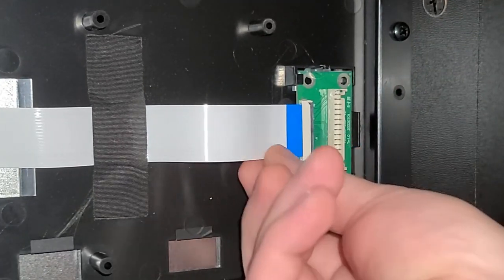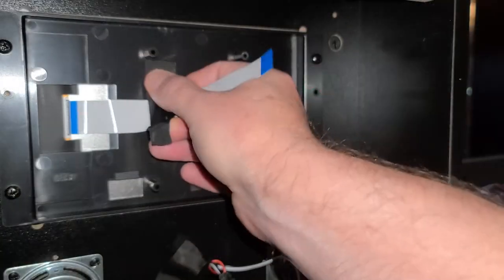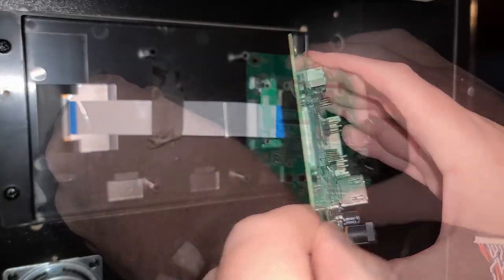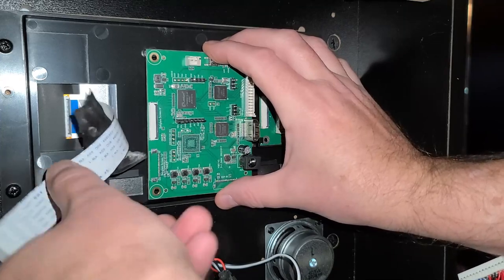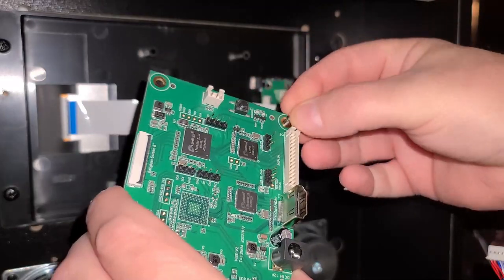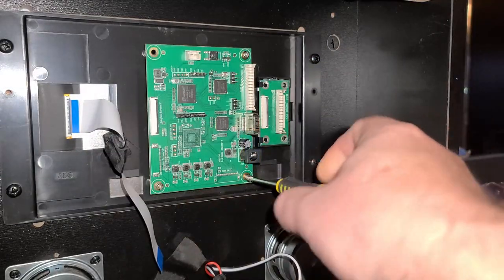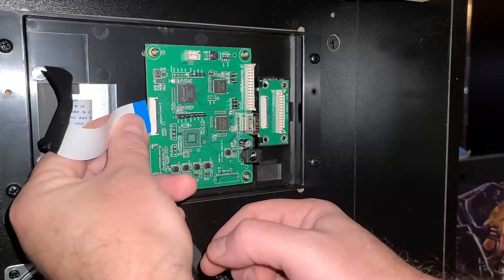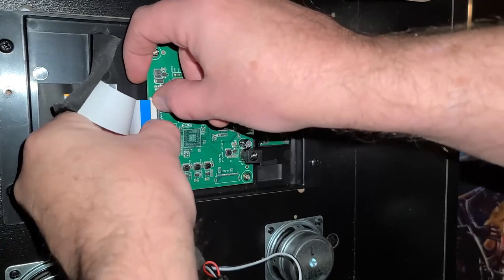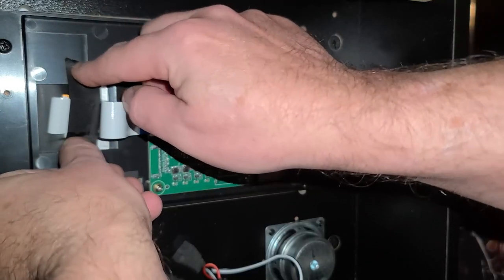For the FPC cable, gently flip the black tab on the connector upward, then you can easily slide the FPC cable away from the connector. Now take the VIBS board, make sure the black tab on the FPC connector is already raised up, and check the orientation before installing. Take the four screws, position one into one of the top two holes on the VIBS board, and screw it into the mount. Repeat for the remaining three screws. Now slide the flat FPC cable into the connector and gently press down on the black tab from the top and bottom to lock the cable into place. You can use the existing electrical tape to tidy up the extra length.